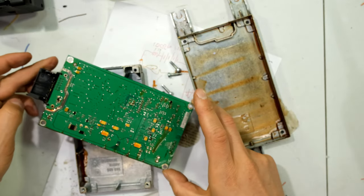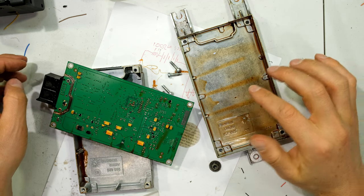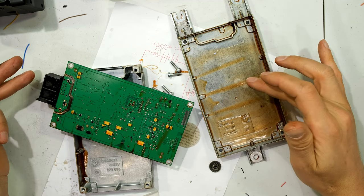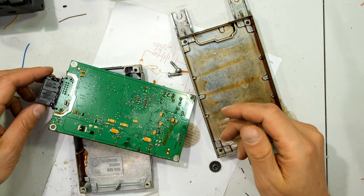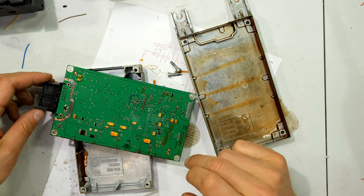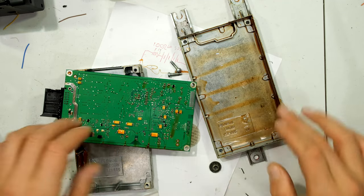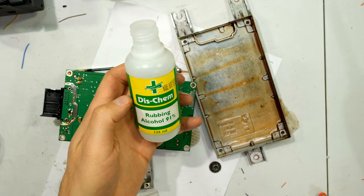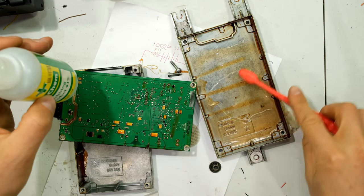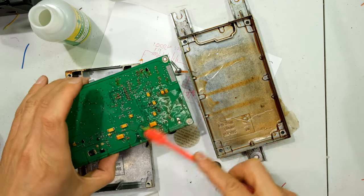Some things I want to bring to attention: I noticed the fault only occurred after the car was on for some time. Notice how this is very sticky, but obviously when it warms up it gets more runny, and being more runny it causes more shorts. Also it was worse when the car was in the sun — again, if the oil was heated up it would move around and cause a problem. So I need to clean this up and put it back, cleaning with a toothbrush and rubbing alcohol to loosen the oil.